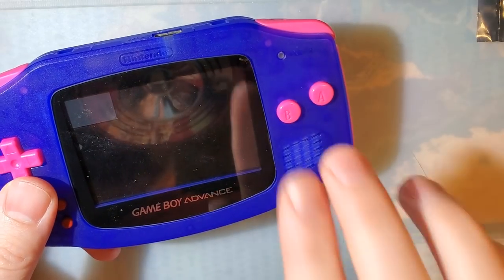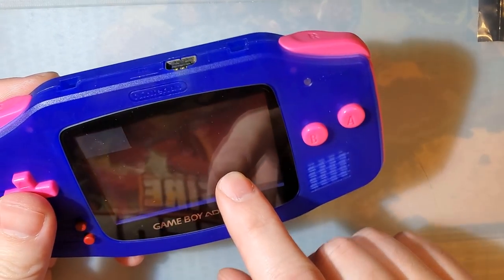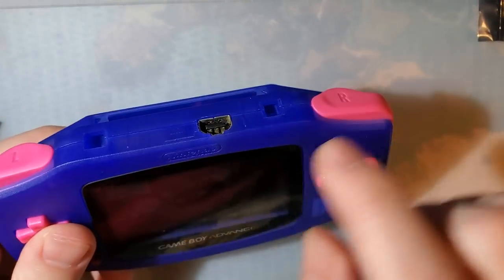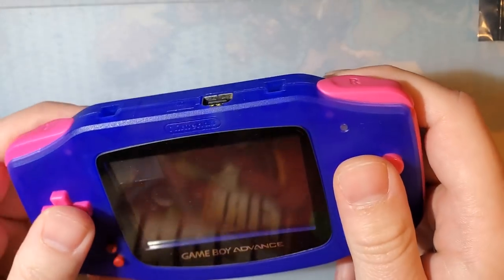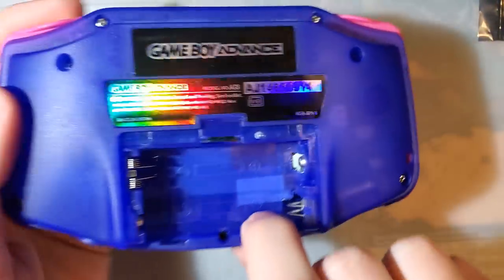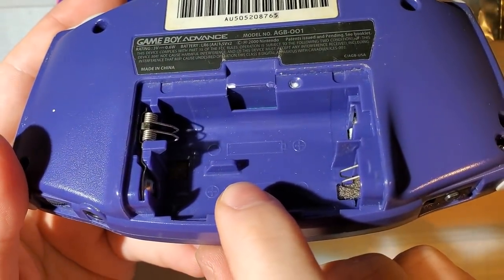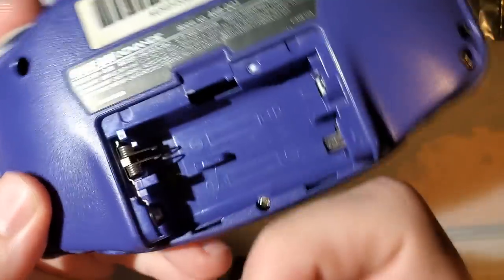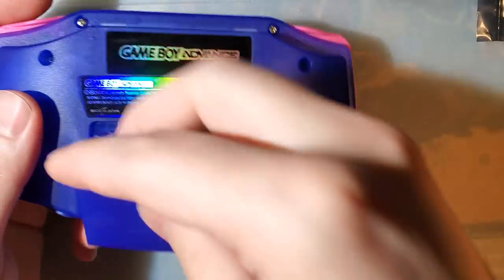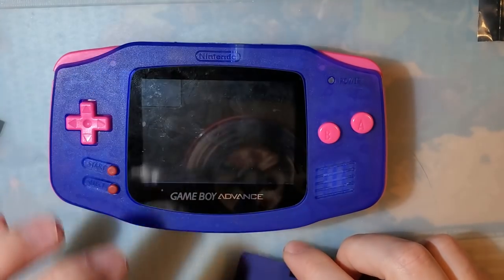If you want buttons, you do have to order them separately. If you want a lens, it shouldn't be too big a deal because your IPS kit should have come with one. You can reuse your membranes from your original Game Boy Advance, which you need anyway — if you want to put a functional Game Boy Advance in here, you need to start with a functional one. One cool thing I noticed: the battery compartment is custom molded compared to OEM, so it is ready to take a lithium-ion battery. This shell has none of the tabs that stick up in a stock mold — it's completely flat and square, giving you more room for lithium-ion mods. Personally I like regular old AA batteries, but it's nice having the option.